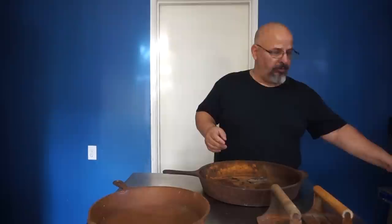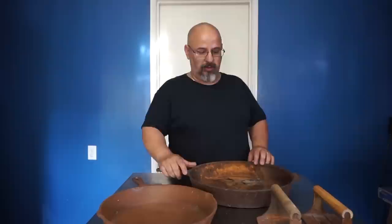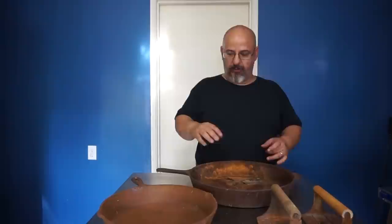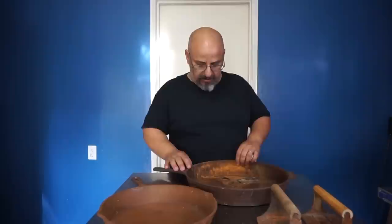What I'm doing on this one is because it's basically all rusted — it doesn't have any crud or carbon buildup. We're going to go ahead and do a water and vinegar soak. Put it in the tank and leave it there for about a day. I usually leave it for a whole day. Let it all soak in and all that rust comes right out. I know some people say 30 minutes, but I leave it there all day. Sometimes I put it in for two days, sometimes three, depending on how bad they are. This is all rust so it'll come out pretty quick within a day or so.